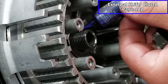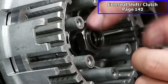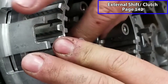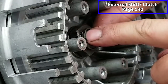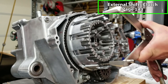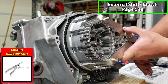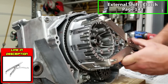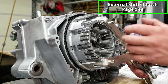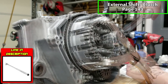And now I'm gonna put red Loctite on here. I prefer red Loctite over the locking washers and also over the peening method, which is the way that these come from the factory. I don't know if you can see the little dent right there, but that's from it being peened. Now I usually use an impact gun. You guys that follow me probably know that, but I just got these new Tusk clutch holders. It's like a set of vice grips. Get them in there, clamp it down. Doesn't need to be super tight because the basket is really not that strong. Doesn't need to be crimped down. You can crush this. So we're good right there. And then we're gonna tighten this down to 75 foot pounds.